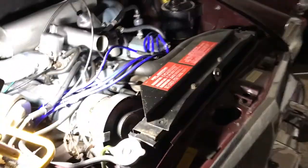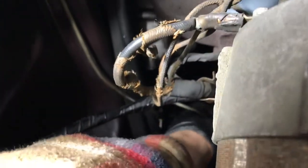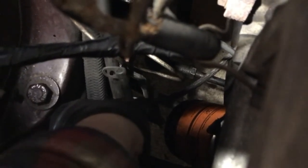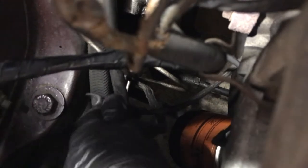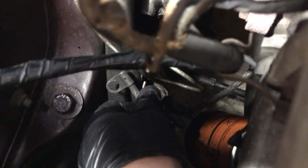While I've been doing the brakes I've been under the car with the brake pipes, and while I was there I found this underneath the frayed wiring of my alternator. That is the engine earth strap, which was not connected to anything. This should be, I think, under the subframe mount here on the offside. So what I'm going to do is find a nice place to put that with some nice clean metal on the chassis. Hopefully that will solve my starting issues and my battery drain.